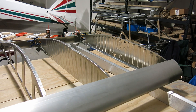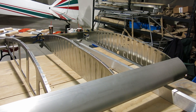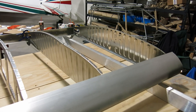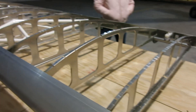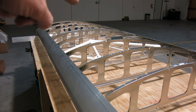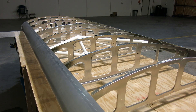So what's next? Next is the cable — aileron cable, Teleflex cable for the flaps — we'll get those installed up next time. We'll install the hang tab. And we have to step drill the holes for all of the wiring grommets that are in the ribs, we'll get those done.